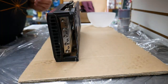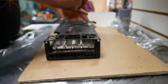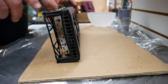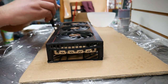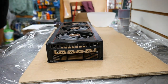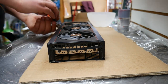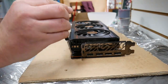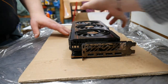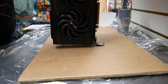It's very important to remember everything you took out, where it came from, and how it goes back together. I didn't start with the backplate — I took out other screws first because I wanted to spend as little time with the GPU actually exposed. I wanted to take as much off as I could, then take it apart and keep the cooler and the PCB together while I waited to finish painting the shroud and backplate.